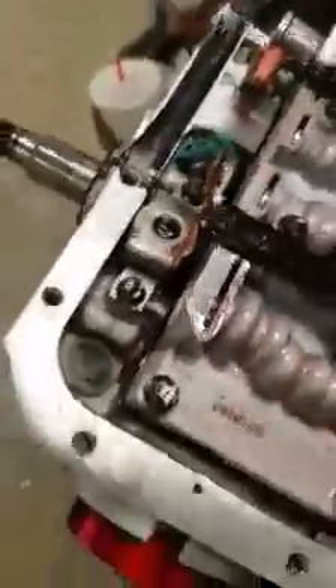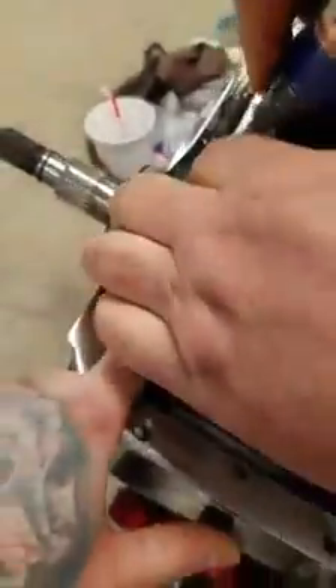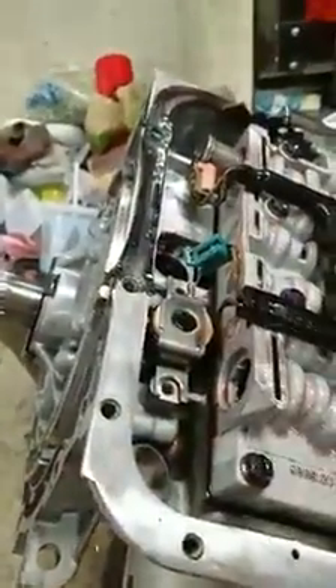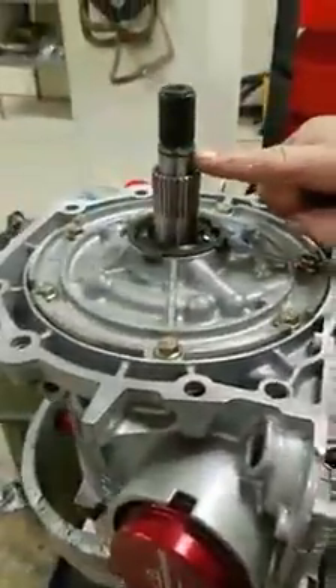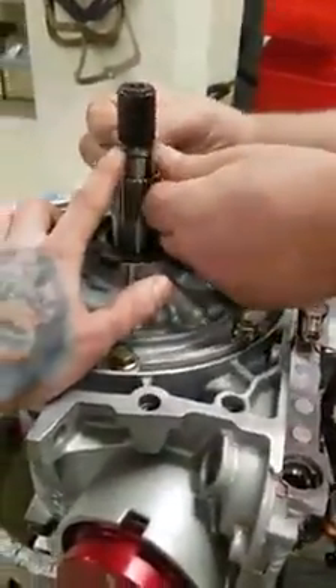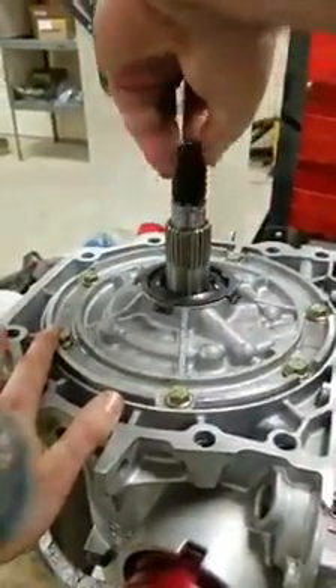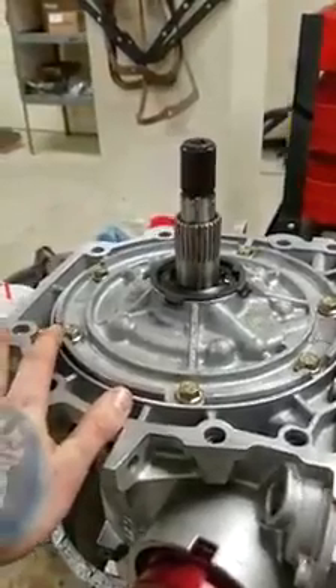The reason we're doing all this is because this TCC has to come out of the pump. If you just yank the pump, it'll snap it in half — and that's a whole other video of changing the wiring harness. The thing people most forget is the lock-up o-ring. You will never get the pump off if you do not take this off. You might be able to, but it's going to be hard.